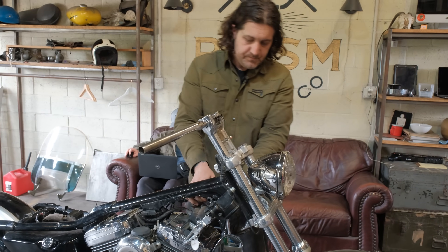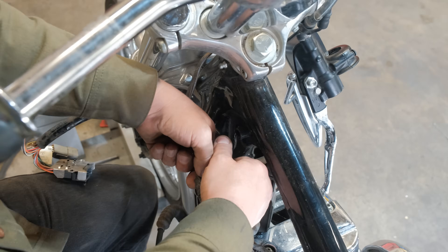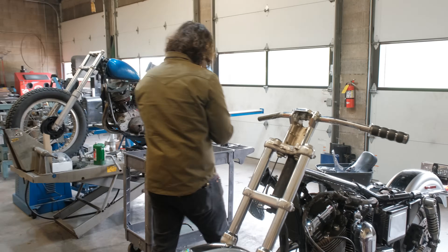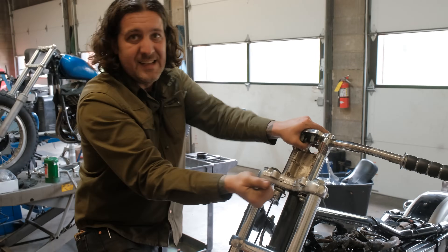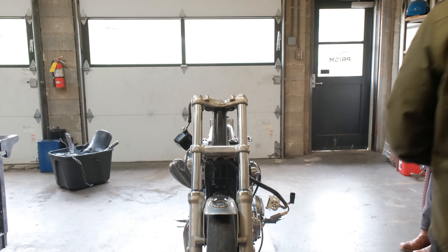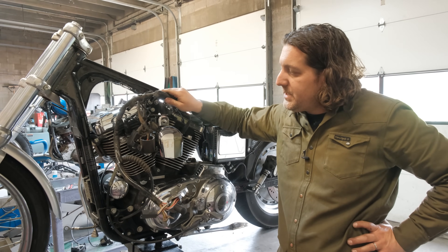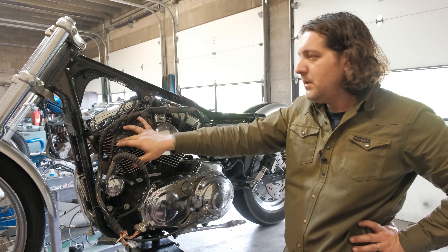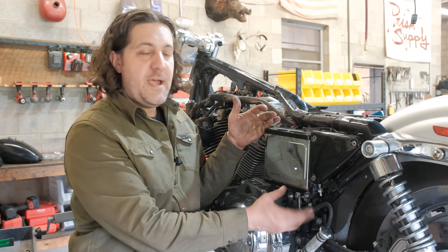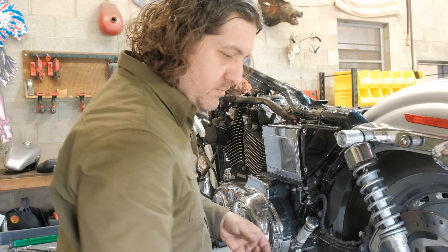The next thing I'm going to try to get off is the headlight. I'm going to chase that wire back to the plug — and luckily there's a plug — and just remove it, then unbolt it from the front. Now that I've got this all loose and free, I'm going to take the key and the coil and move them back, take this horn off. For our coil relocation kit, you're going to have to remove the battery mount down underneath here, so I'm going to grab that — remove the battery so we can get everything and run the wires back up to the cylinders.